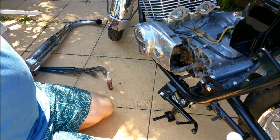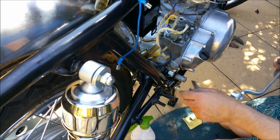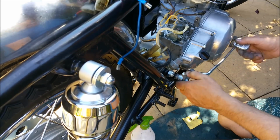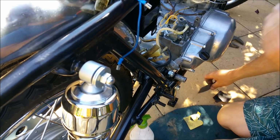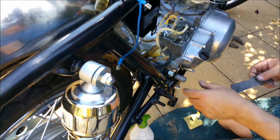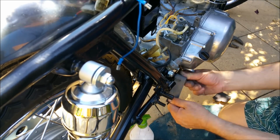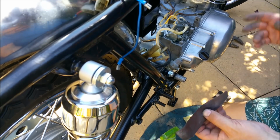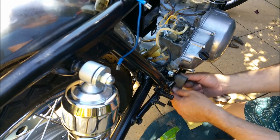That's cool, right. I've just popped this muffler off again. The powder coating on that thing was making the brake pedal bind. Normally when you send something in for powder coating, if they don't already see it, I always put a bit of masking tape around the parts I want protected from the powder coat. The powder coaters can then see it because it's orange and just put their special tape on, because the oven's 300 odd degrees and masking tape won't last.